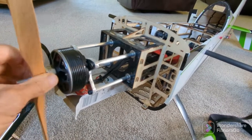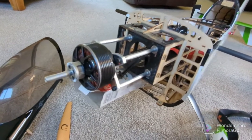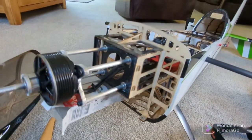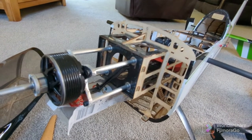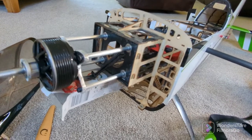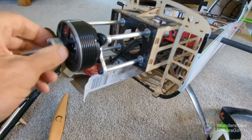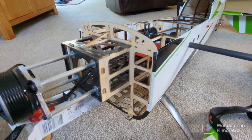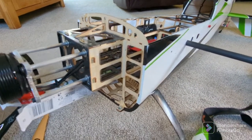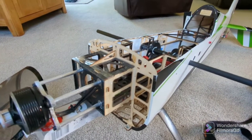But I don't think that's a problem. I think keeping it on full power isn't the problem. Well, I know it's not. It's the ripple voltage, definitely. It's the mid throttle where it's been cutting out, nowhere near full throttle. Where it's going up, where the PWM signal to the motor's going on and off, and that's where you cause it. And then when you get this ripple from the voltage drop on the battery, that's when it buggers your ESC up, and then once your ESC goes, you're dead